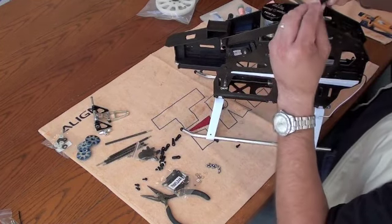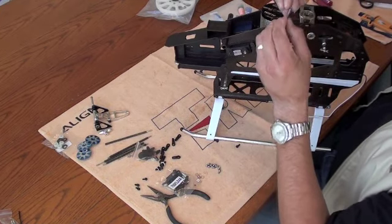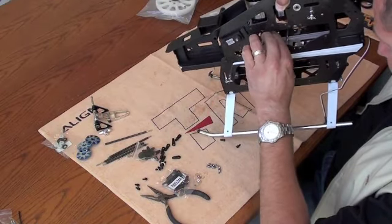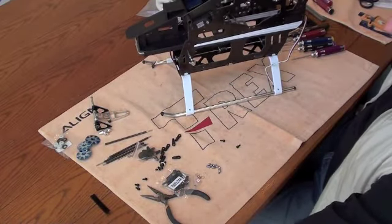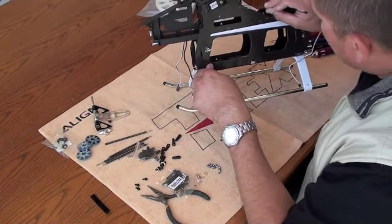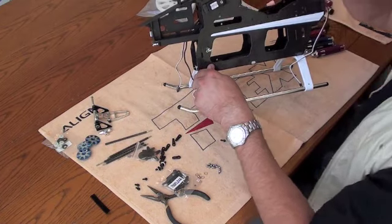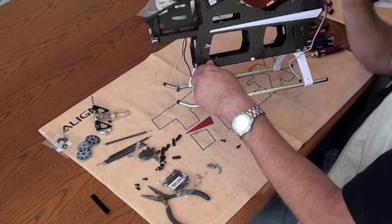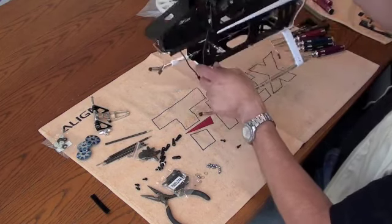I don't know, if you get your Velcro, not the fuzzy side, but if you look at basically this flat side here, that's pretty much the gap that you're going to see down below it. Or let me see a zip tie. Just that way you have a visual reference without trying to get something to measure it. Basically, it's about the thickness of a zip tie that's included with your kit, the gap. Maybe a little less than that, but almost the thickness of this. So when you're looking at a zip tie, that's the gap you want to have there.